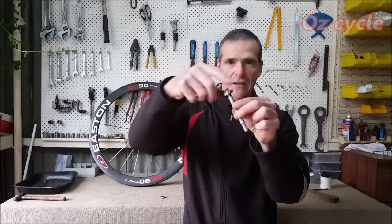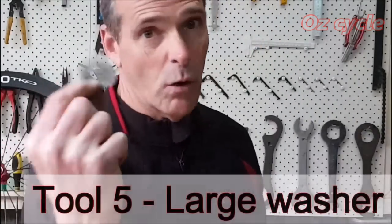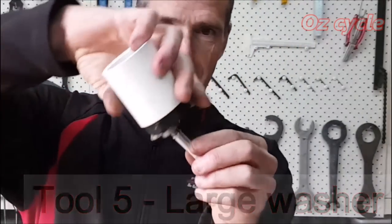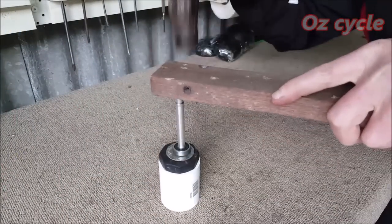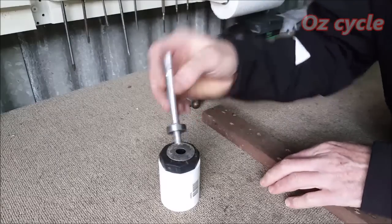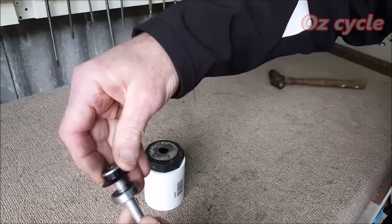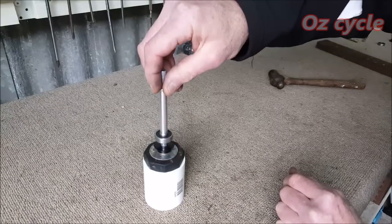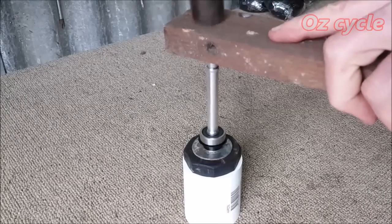Everything's pretty much in reverse putting it back together. Here's your axle and your bearing — just press it on. If it doesn't press on with your fingers, you can use your hi-tech washer. Put that on and use the piece of poly — never hit your axle directly. Tap it down. Same thing with the dust cap if it's hard to get on — start it off, place it in the center of the washer making sure the axle can go through, then use your piece of wood to tap it in.